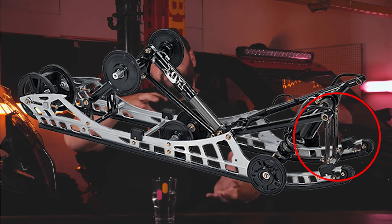There are also limiter straps on that shock and all the suspension components. The limiter straps limit how much the nose can raise or lower — the looser the limiter strap, the higher that nose can ride. For the rear skid springs, they're just preloaded, so as long as the machine sits at a nice height when you sit on it, that's all you need to do with your spring. Your back shock just has to do with the chop and bumps you're gonna get, so adjusting that to comfort is ideal. That front shock on the rear skid is where the whole balance of the machine happens.